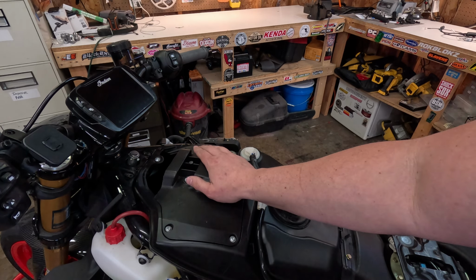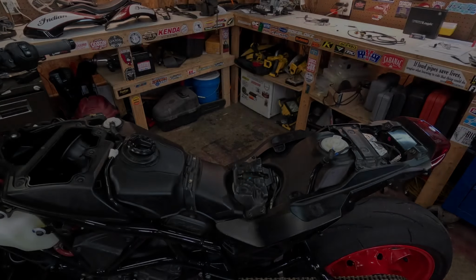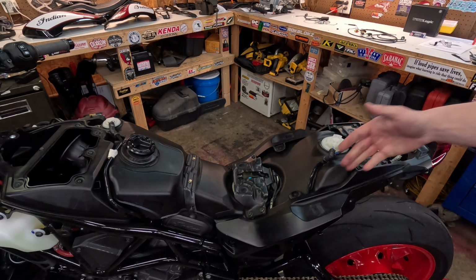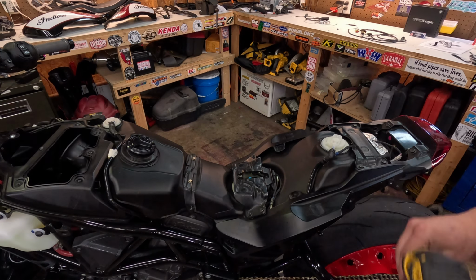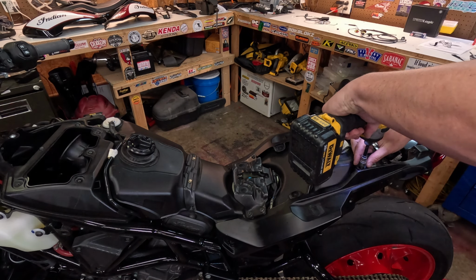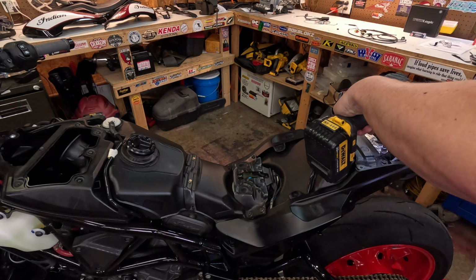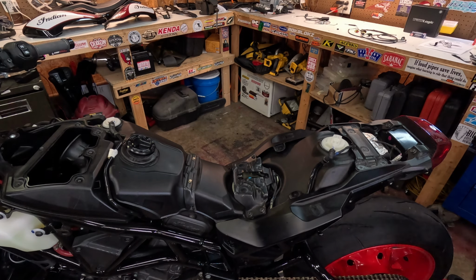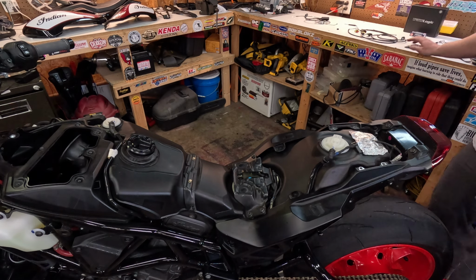And then we're gonna pop this cover off and get our air filter out of there. All right, now while that's sitting outside drying, we're gonna take this bracket off, and the tail light off, all 10mm bolts, and they're all the same length. So you don't need to worry about where they go. Obviously these brackets only go in one way. That's pretty idiot proof too, obviously it's not gonna fit that way, so that's pretty easy.